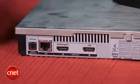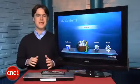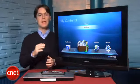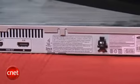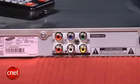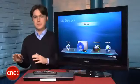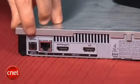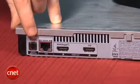The idea here is if you have an older AV receiver that's not 3D compatible, you can send 3D video right to your TV and use a separate cable with audio to go right to your receiver. However, it's worth pointing out you don't need dual HDMI outputs to use an older AV receiver, because you can make a separate connection with an optical audio output, and most people won't be able to hear the difference.